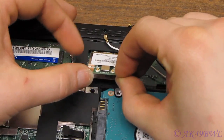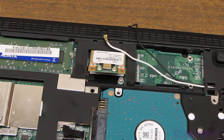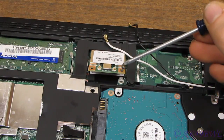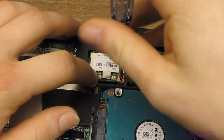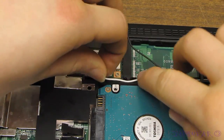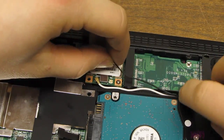Put the card in at about a 35 to 45 degree angle, push it in until it won't go anymore — don't force it though. Grab your screw and hope you have a magnetic screwdriver, because that makes a whole heck of a lot of difference. Get it started in the hole, push down the card, and screw it in. Get your wires, and they just snap on — should not be difficult at all.